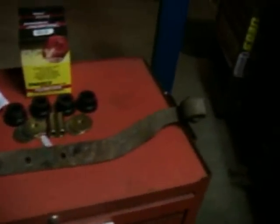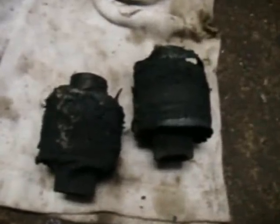I had to look through my junk pile and found another one — not quite in as good a shape cosmetically, but I'm pretty sure it'll clean up. This time I'm going to follow the instructions and burn out the rubber and reuse the sleeve. Step one's done — I took it outside, got the oxygen-acetylene torch on there, got it real hot, and once those things get melted they just push right out. Don't want to do it inside though — makes a real mess, smoke and all that. Next step is to get it in the bead blaster and clean it up.